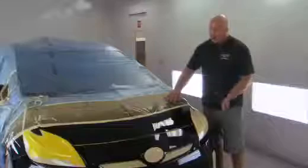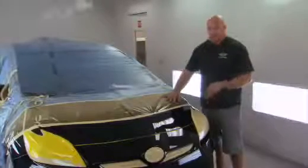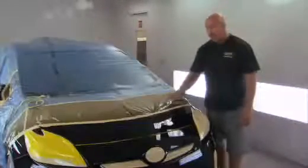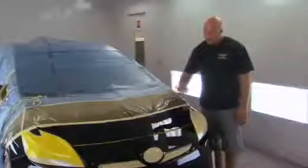Now that the Armor Coat has been applied, this vehicle is air dried in the booth for approximately 10 to 15 minutes. As you can see, the product is no longer sticky. We normally like to wait another 15 minutes before we unwrap the vehicle in case there is an issue of tape falling on it. The line on this vehicle turned out perfectly — this is one of the main crucial areas: make sure you get this line off while the product is still wet.